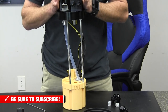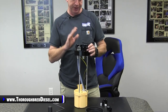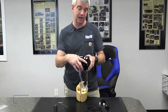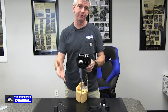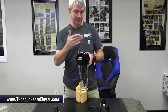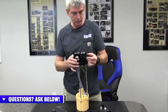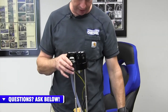For the 24-valve trucks — that's the one I want to center on because I think it's going to be a humongous mover for us. This will work for a stock fuel line: you have your stock size injector or high-side return, and then your stock size fuel delivery line for your lift pump, and that works just fine. Now if you have an aftermarket lift pump with a half-inch fuel line, what you can do is remove that and use one of the AN fittings that comes in the kit from Fleece. Get yourself a male push-to-lock and you're good to go on the suction side.